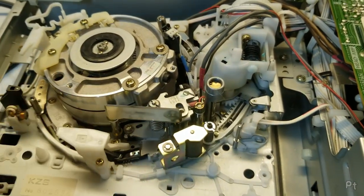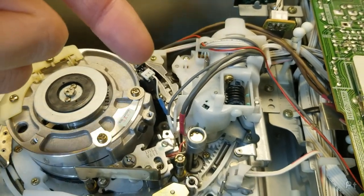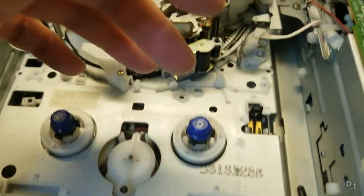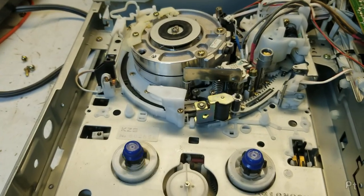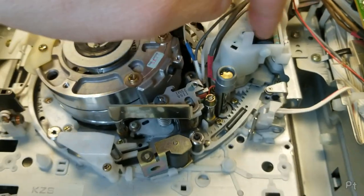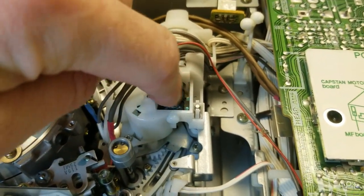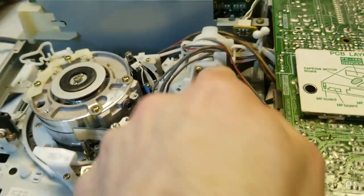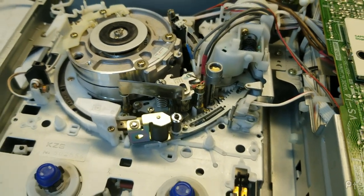I think it's my original assumption. I tried helping the motor to load all the way, and it's still freaking out. I was able to get it to load all the way and it was happy — did a little dance with the pendulum — and then I was able to hit eject. But this is still trying to move. See, now it's trying to load but it's like stalling out. I think the motor shaft is slipping in this little gear here. It should be going this way all the way, and it's fighting. Something's weird here.